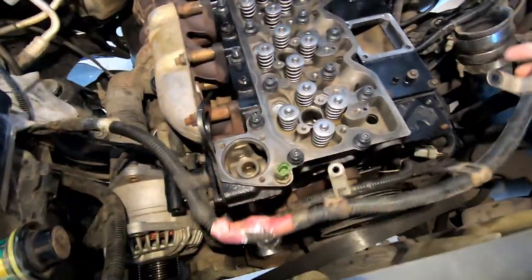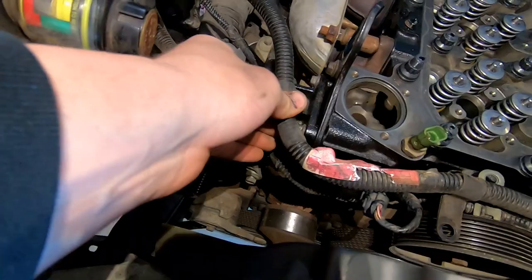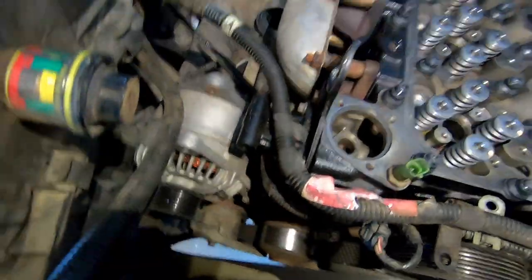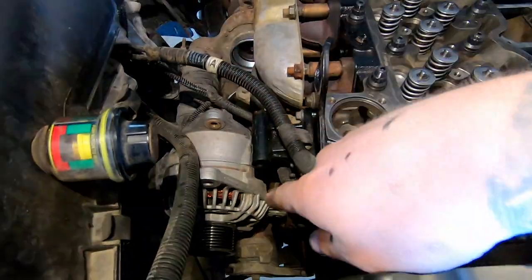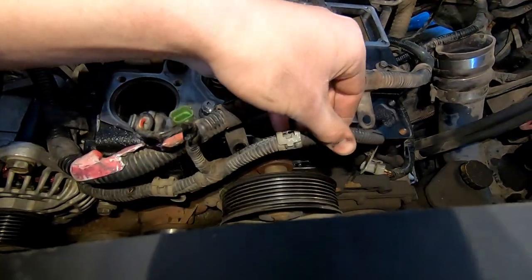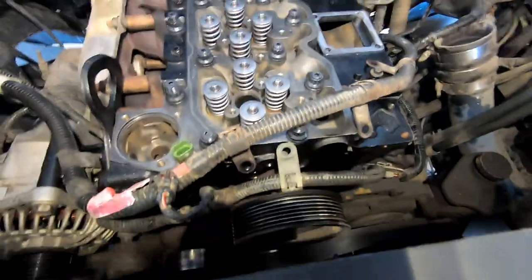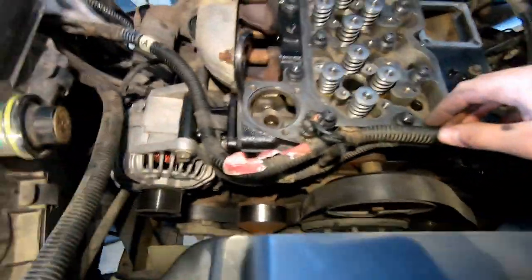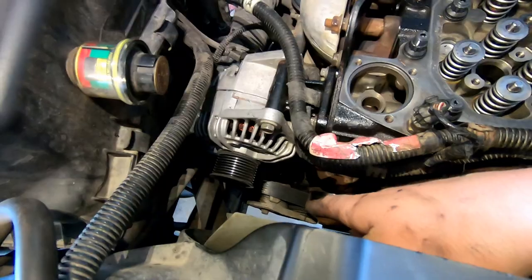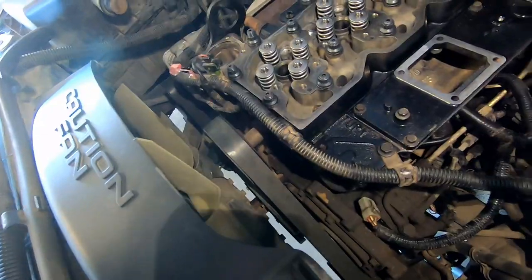Put the little bolt down here in that coolant line and bolt that back up on the side of the block, then throw your heat shield back on the exhaust manifold. Now fold the electrical wiring back over — this is for the grid heater. There are also wires under the alternator bracket; one clips on underneath, one clips on over top, and there are a couple of nuts to hold the wires in place. Slide the alternator back over, put the bolt in, tighten the bottom bolt, then secure all the wiring to the front of the head. Get someone to help, loosen the belt tensioner, and get the belt back on your alternator.